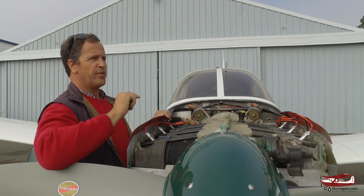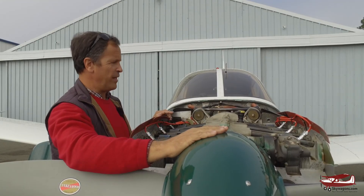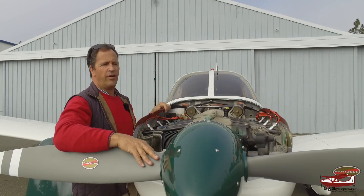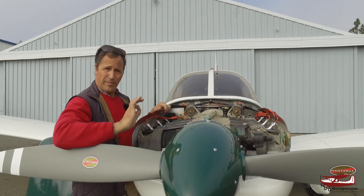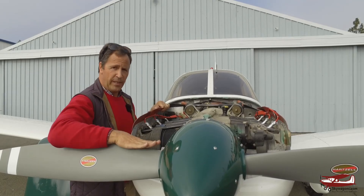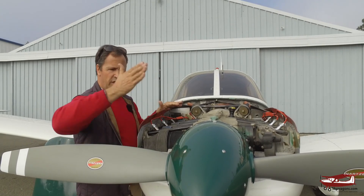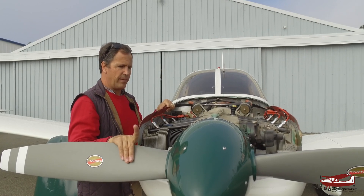This plane was built in response to Cessna's success with the 182. Piper took a Cherokee 180, stuffed a 540 in it, put a constant speed prop on it. These planes have a useful load of like 1400 pounds — it's almost the weight they weigh empty — so they're incredible load haulers. If you live in hot, high, heavy Colorado or New Mexico and you want a Cherokee fixed gear, easy maintenance, easy ownership but with some performance, you get a 235. Now, 235s aren't all constant speed. Some of them were built from about 63 to 65 as fixed pitches — a 540 fixed pitch, fixed gear, but over 200 horsepower. Those are the early planes.